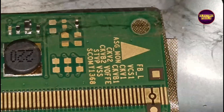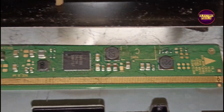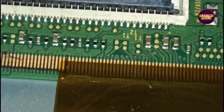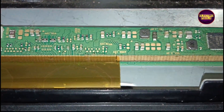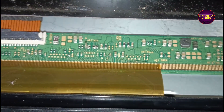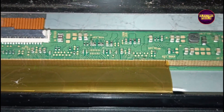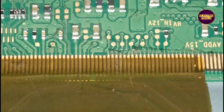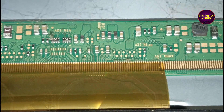This TV comes with a Samsung panel SM4186DC-DCIC. As we discussed earlier, due to internal shorting in gate signals inside the glass panel, this DC to DCIC goes into protection mode.